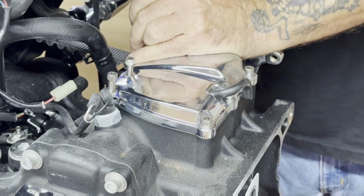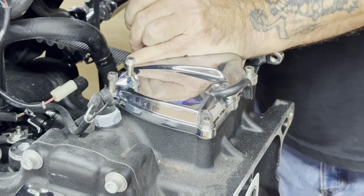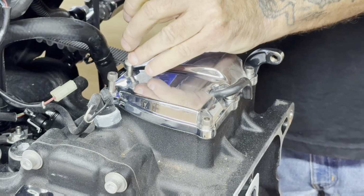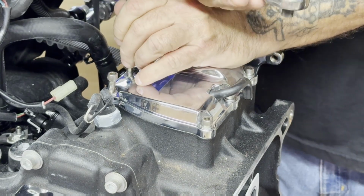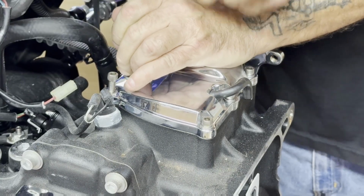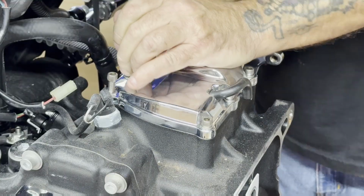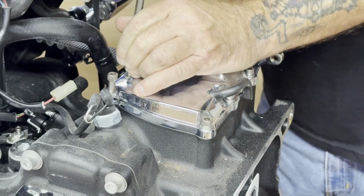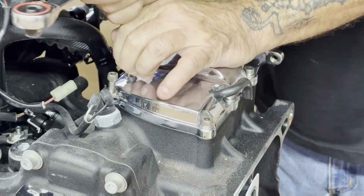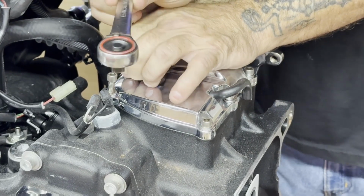Because I have pulled stainless out of aluminum and it was tight, and you will literally rip the threads out because of that stainless grabbing onto that aluminum. For some reason, regular steel's better than stainless, but stainless is better for not rusting and stuff. So I get why he did it, and I don't have a problem with putting those in. But if you're just going to go grab stainless bolts and drive those into aluminum, you need to put some anti-seize on them.